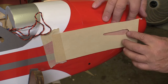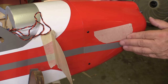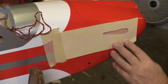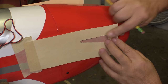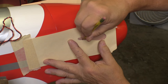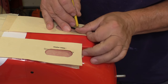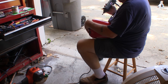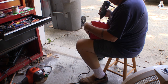After removing the parts that stick through the cowl, we reattach the cowl using its screws. I normally use a fine felt tip pen to mark the openings I have to cut. This time I tried putting masking tape on and drawing the lines on there and cutting through that — it works okay, but I think I'm going to go back to just using the felt tip pen. This is worth taking the time to do: a nice clean template means we're going to get better results the first time we cut the cowl. I trace out all of the openings I'm going to have to cut before I remove the cowl.